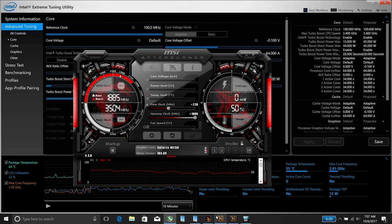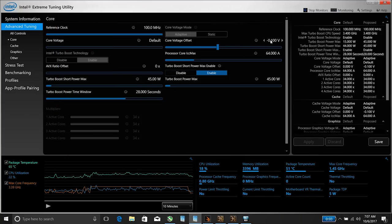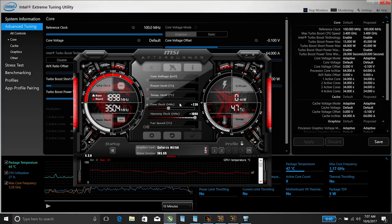Another benchmark I've also run is Fire Strike, and this is again with the overclock — so this is the maximum it's going to get. This is not a gaming laptop, remember, so these scores are quite low. The physics score is very decent though, probably because I've also undervolted and increased the power limits, so the TDP has gone up over stock to hold the cores. What I'm trying to do here is get it as hot as possible — hotter than stock — but I also believe that when people decide to game on this, they are probably going to overclock the GPU.